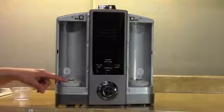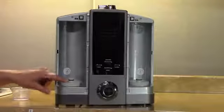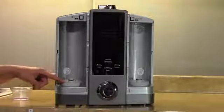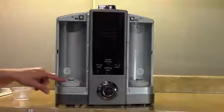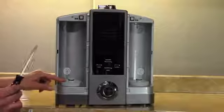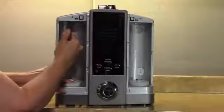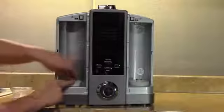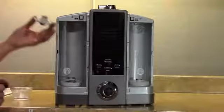To remove the cushion, you will need to press down slightly on the cushion and rotate it so that the tabs in the base will line up with the slots on the cushion itself. Usually you'll need to use a flat blade screwdriver to do this. Once the tabs are lined up with the holes, you can remove the cushion.